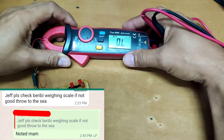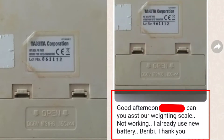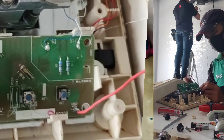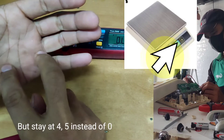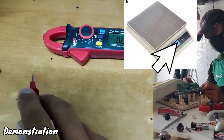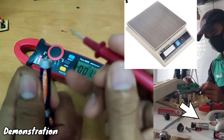I received an order from my boss to check the Tanita KD200. The complaint is they already replaced the battery but the issue is still not working — there is no power. When I check it, the power button doesn't respond, but once you shake it, it responds. However, it will not read and gets stuck on. If you turn it off it responds quickly, but once you turn it on it cannot. Sometimes you need to shake it in order to power on. I checked the batteries and there is no problem with the batteries.